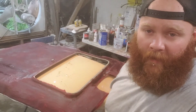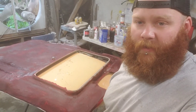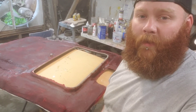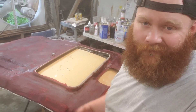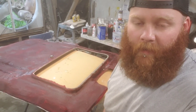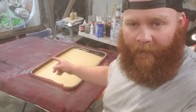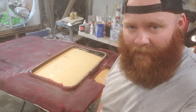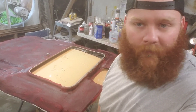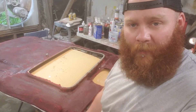We've got our headliner put back together and the resin put down on the fleece — it's still tacky right now, we're waiting on it to dry. Whenever it dries we're going to sand it, then go back over probably just where I cut it with the fiberglass matte. Something I knew when I first cut this apart was that glassing it back together was going to make it a little bit heavy. So I don't want to add too much weight, because all you've got in the middle to hold it up is that magnet right there. I'm possibly going to add another magnet — that way it has two — or I may just put a bigger magnet on it, because you don't want to be riding down the road and have it fall out.